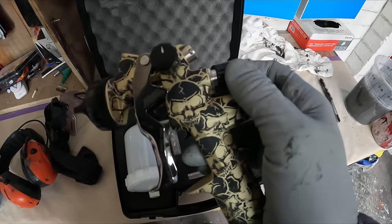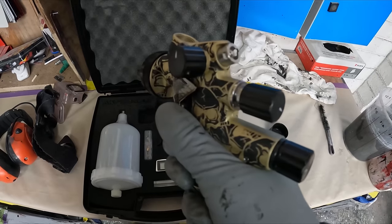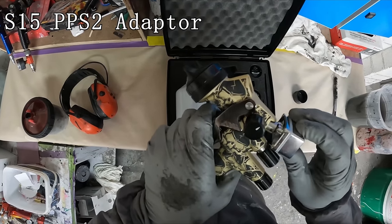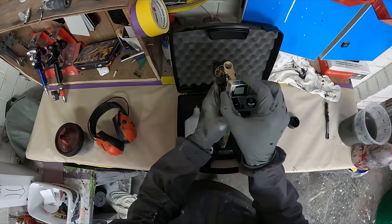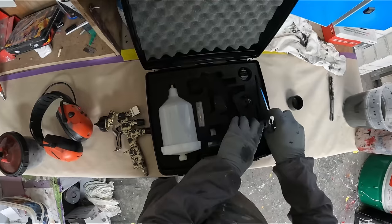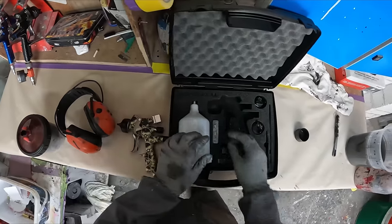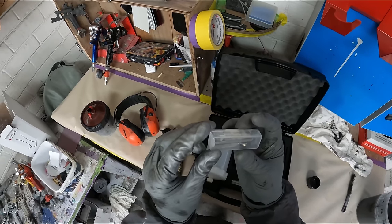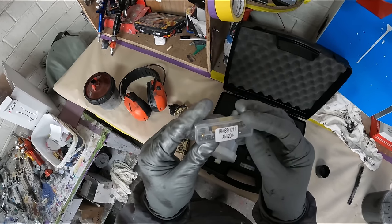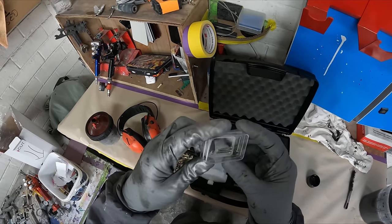For regular daily use I don't even need to take the gauge off, though you do need to clean clear overspray off it. It is solvent and thinner resistant. The gun weighs in at about 455 grams — not ultra heavy, not ultra light, about what you'd expect. It's got a nice feel in the hand. Some of the knobs are in slightly different positions than the DeVilbiss — the main thing is the air adjustment knob is up the top instead of down the bottom like most DeVilbiss guns.